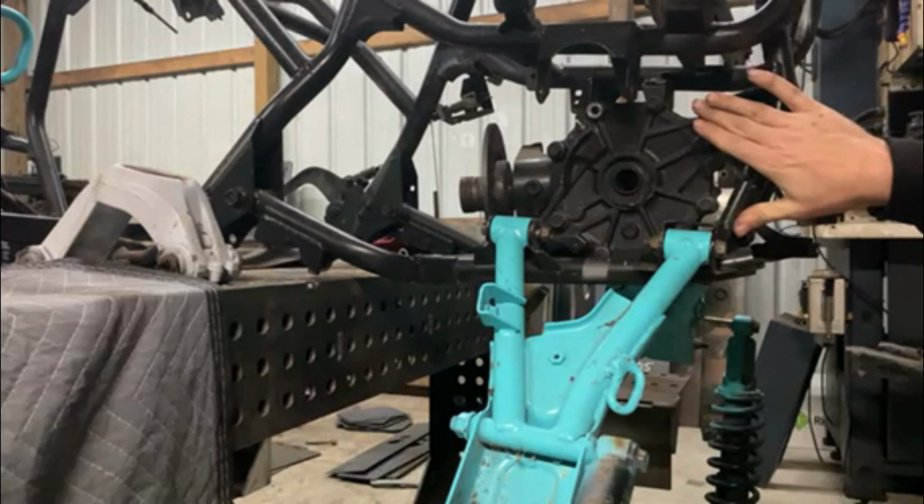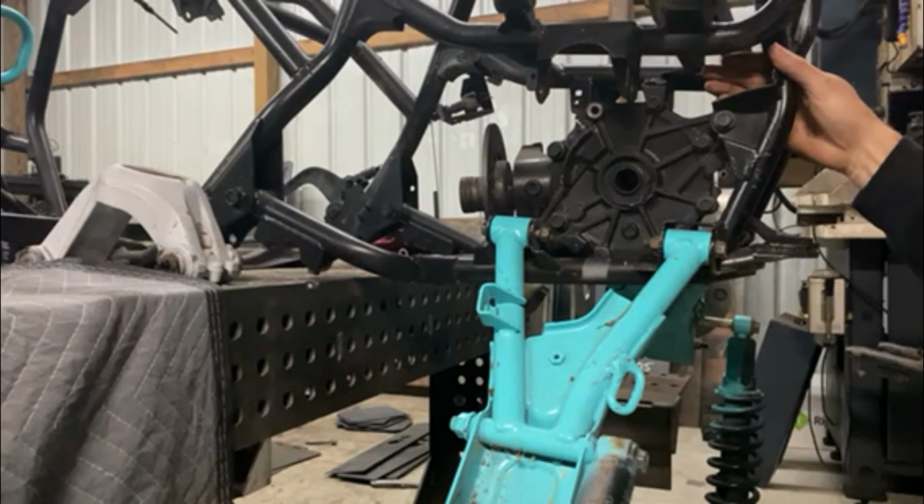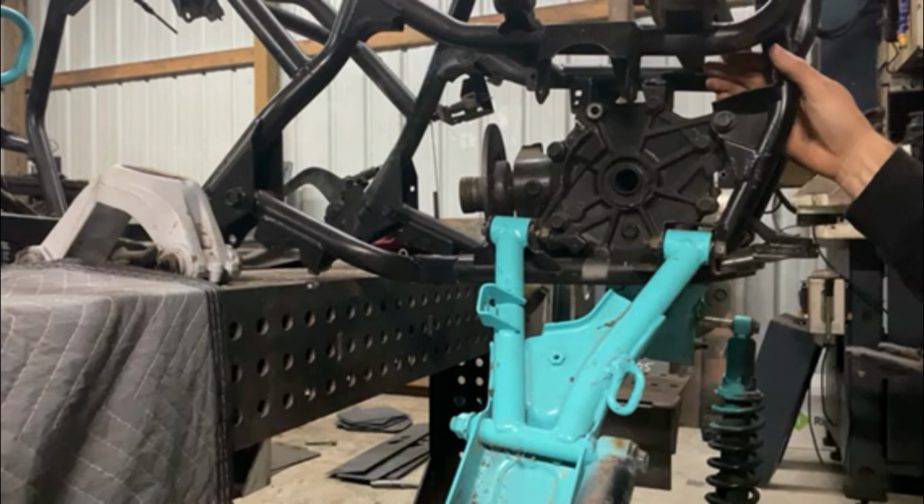Now, the rear diff bolt does have a bushing on the back side of it. We're gonna have to have some bushings machined. The first couple we send out, we'll probably just cut some pipe just so they can be tested. We're probably gonna order a lathe Monday morning. So first thing in the morning, we'll order a lathe so we can start turning our own bushings. That's also gonna play a role in the timeline on when we actually can ship these out. I would expect us to be able to get a lathe within a week, I would imagine. If it looks like it's gonna be over a week, we'll probably just go to the local machine shop and I'll just eat whatever they wanna charge to turn down some bushings. But I know they get $100 an hour, so I can just imagine the price of them turning down some bushings.